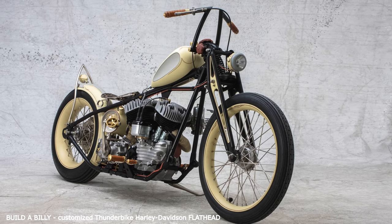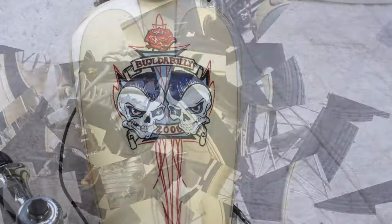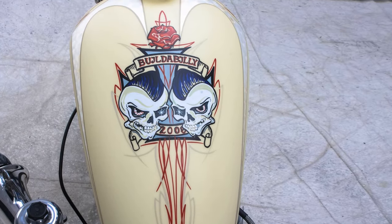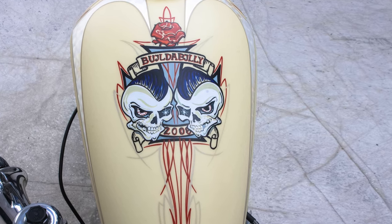We made the peanut tank even narrower by making the sides curved in. The side-mounted tank fuel taps were closed and refitted in a different place. The oil tank had to be made from scratch, also with curved sides to match the gas tank, and sloped to fit the frame.